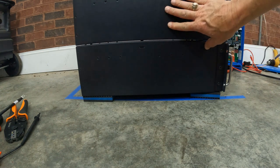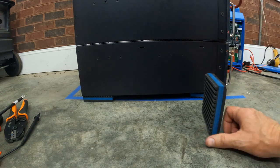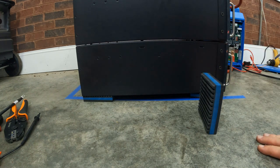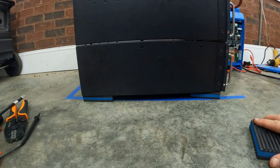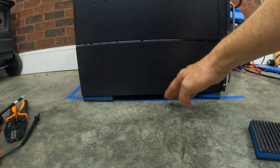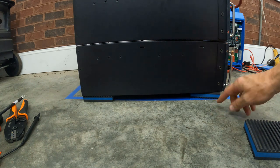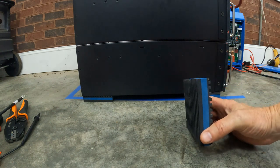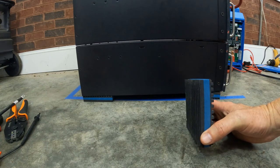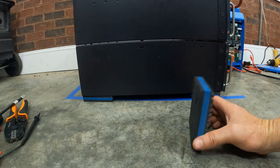The last item is the anti-vibration pads I placed under the batteries. These are server rack batteries meant for data centers, so I bought anti-vibration pads to reduce vibration while driving with the base camp. I thought they were about 3/4 of an inch but they turned out to be almost a full inch thick. When I measure up to the top of the battery and compare with the clearance to the bottom of the seat or bench in the base camp, these pads bring the batteries just under the 17-inch limit — so I'll likely remove or cut them down.